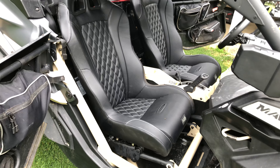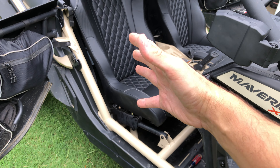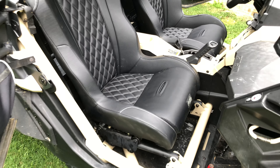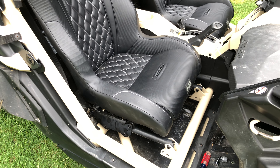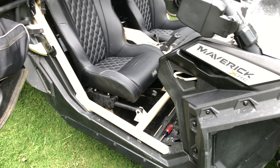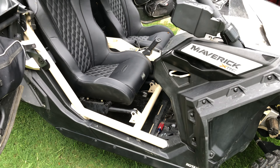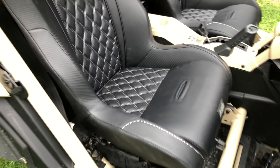For the driver's seat I mounted the bracket to the seat, got it all together, and then put it in — but the problem is it's harder to get a good square alignment that way. So for this one I simply yanked the stock seat out, put my bracket together, bolted the bracket on top of the rollers and the seat mounts, and then it was 10 times easier — just set the seat in, put the bolts in one by one, and tighten them all down. I would simply bolt the mounting kit to your rollers and then set the seat on it. Way easier.